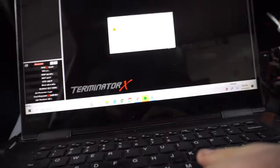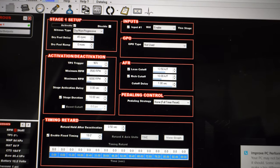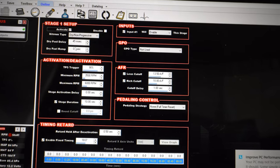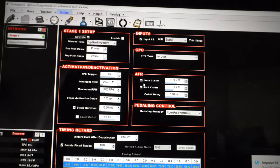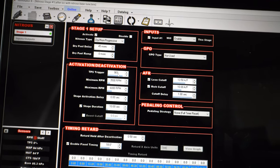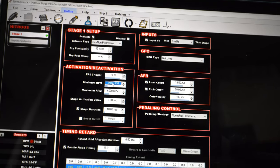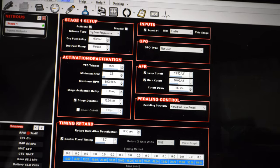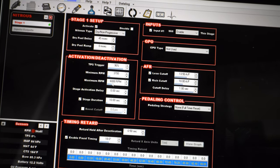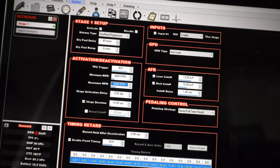So here's the nitrous setup I'm going to go for — hopefully you guys can see this okay. Nitrous setup: I just did some research. 45 millisecond dry fuel delay since the solenoids are really close to the plate. 90% throttle trigger at 3,500 — on the converter it was like 3,200, so I might actually turn this on more like 3,700 just to be safe. Then in the burnout I'll probably turn that back down, maybe even 3,800. Off at 6,000.